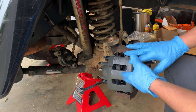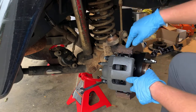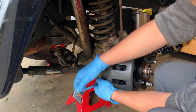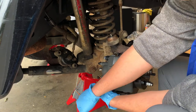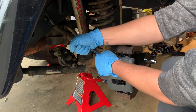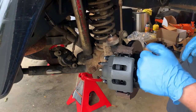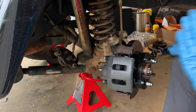If you have a dual piston caliper, which is a big brake kit, it's like 15 or 16 foot-pounds, and that's an extreme amount of braking force. These are 11 to 12 foot-pounds per the Black Magic brake instructions. They specifically say on the outside of the box, do not put a lot of torque on these. So 11 to 12 foot-pounds, you can use a torque wrench, or I'm gonna use my torque meter. Click. Click, click, click, click, click. Okay, that was 12, maybe 13, might have went one over. Anyways, these calipers are on here now, it looks great.